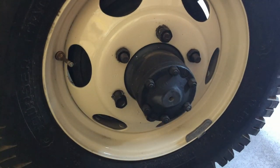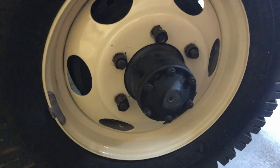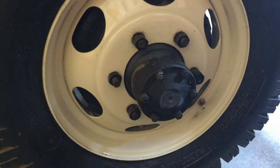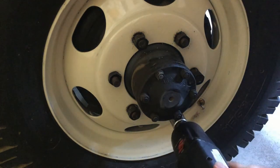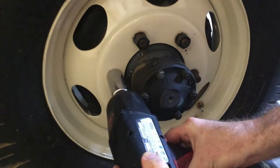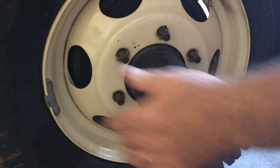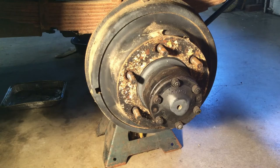One precaution is to make sure not all the threads are left-handed. The issue you get into is that trying to find a left-handed stud on a truck like this is almost impossible — the right-handed studs are easy. Somebody may have replaced one individual stud with a right-handed thread versus a left-handed thread, and I don't like other people working on my truck because they often don't understand that you have to turn these threads backwards to get them off.